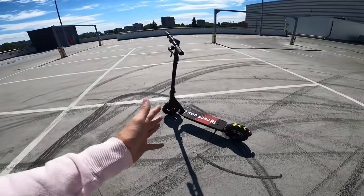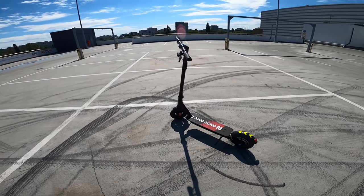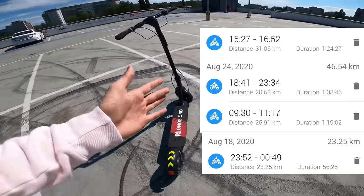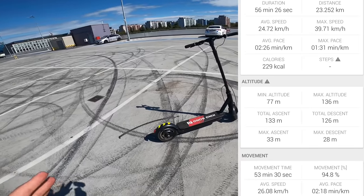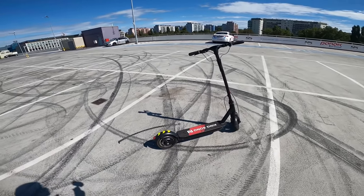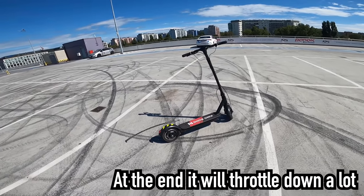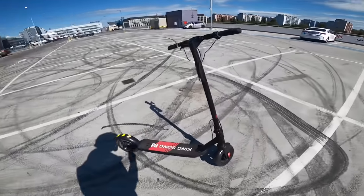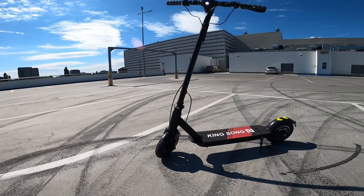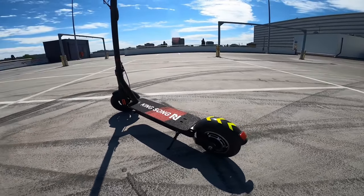This is a 48-volt system with a 505-watt-hour battery, so it sits in between the M365 Pro and the Ninebot Max, giving a range of between 20 and 30 kilometers. I did a lot of range tests in second and third mode. In third mode with high-speed riding you get around 20 kilometers, and in second mode, driving carefully, you can get up to 31 kilometers of range — so the claimed 30 kilometers is actually achievable.